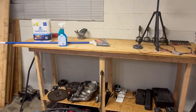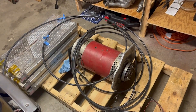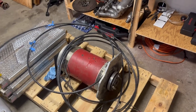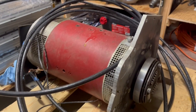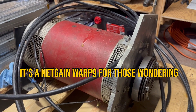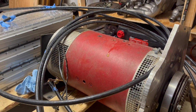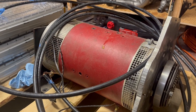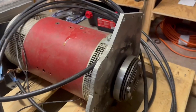The plan is to take essentially a glorified forklift motor. This thing is pretty powerful, makes a lot of torque, probably weighs over 200–250 pounds, and it ranges from 72 to 144 volts. It can handle continuous current of up to 500 amps and peak current bursts of over 1,000 amps. It's essentially a series wound DC motor with advanced brush timing so it can handle a little more voltage, which means a little more speed.